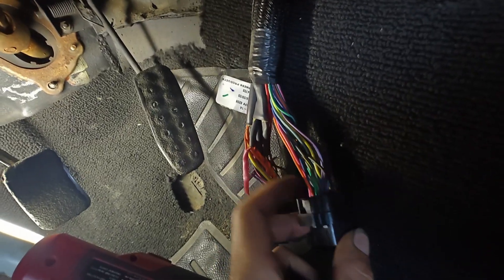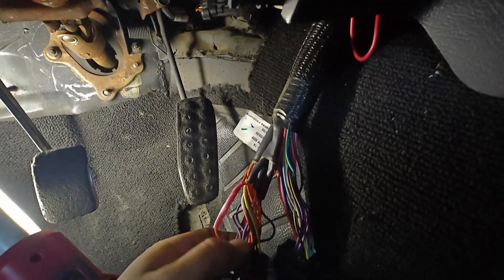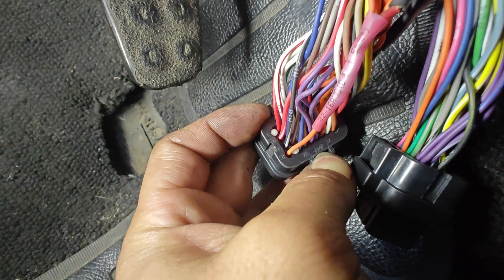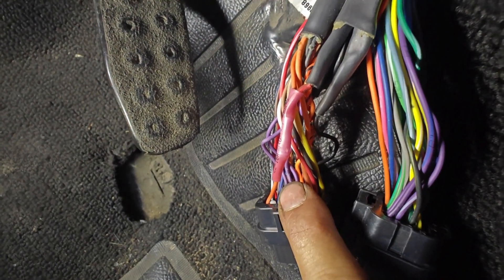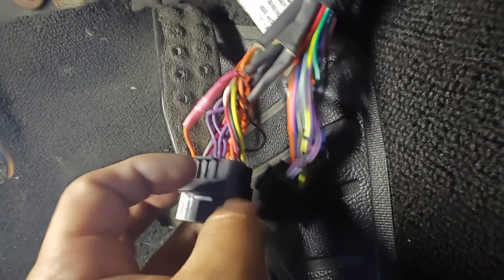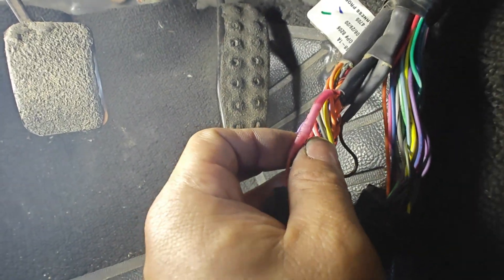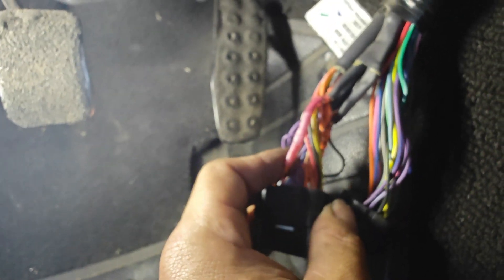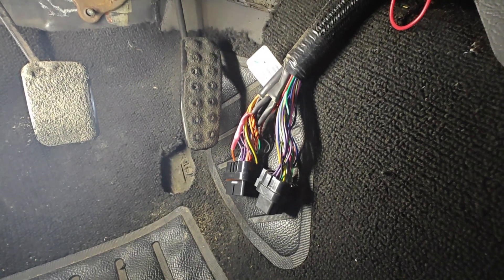Change of plans. I took the P1B plug and removed the 12 volt wire out of B20, which feeds the cam and crank sensor 12 volts from the LS1 harness. Then I went to P1A, pin 26 - there's an orange wire. I snipped it and crimped in the 12 volt wire feed to that orange wire. Pin 26 on the other plug feeds all the five volt sensors in the harness, so I just tied into the 5 volts right there - went straight to the horse's mouth. Nothing's pulling on it or anything, so I shouldn't be worried about it. I cannot stand crimping things but it seems to be working better than the alternative.